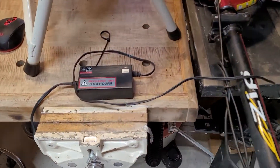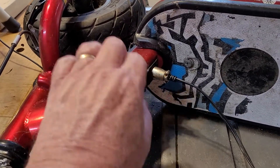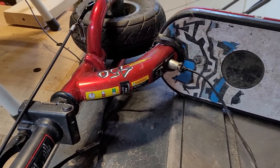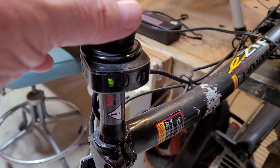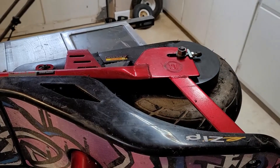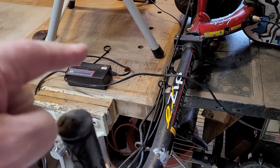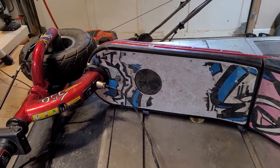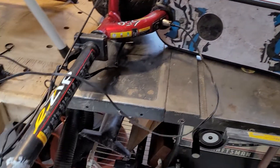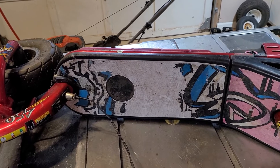So we have it plugged in. The green light is not on. The switch here is on - the battery shows that it must be charging and on the handle there's a green light that says it's charging. This is the throttle. So I'm going to turn the throttle and there's power going through the battery charger into the scooter - so that's all working. I don't know if the battery is holding a charge. It doesn't look like it. So that may be the next place to start - to go see if the battery has dirty terminals or what.